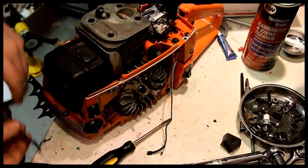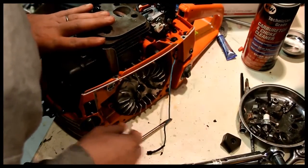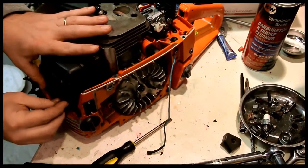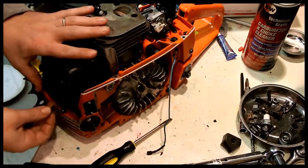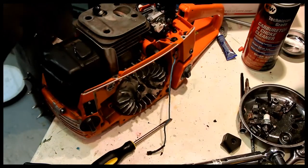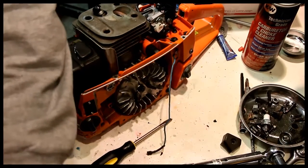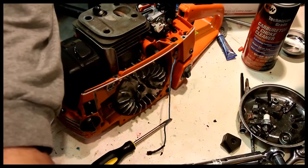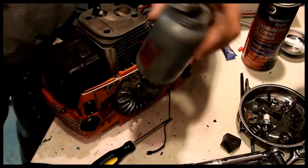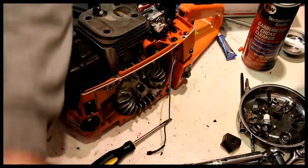Let's put on the exhaust mount. Figure out what bolts go where. 2 short ones. I believe the short ones go actually into the exhaust. Now, if you're going into something that's high temperature, grease is not going to be the ticket. You need anti-seize, the gray stuff. You need this stuff. There we go.